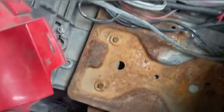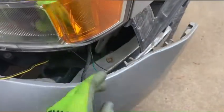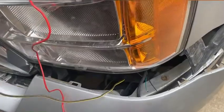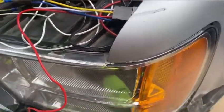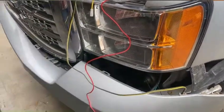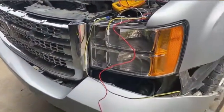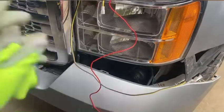All right, let's see what we can get. I'm going to have to pull this tray out of the way — I think that's the easiest way. I abandoned my battery box thing, went in here, and cut my wires. You're going to run one side to this one, and your diagram has how you need to do it. In my case, my blue wire goes to my black wire, and my white wire goes to my green wire. I already tested this — I finagled it together and hooked it up to make sure the pump turns on when I hit the horn, and sure enough it does. I actually have two horns, so I've got one on the other side and I'll retain my factory horn just in case this one goes out. I clipped it back far enough that if I want to, I can just put the clip back on and plug that factory horn back in.